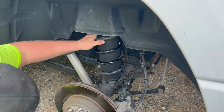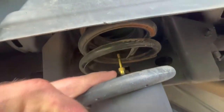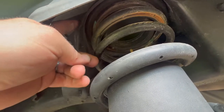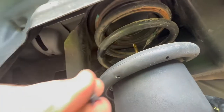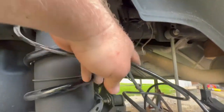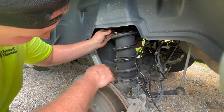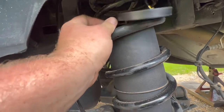With the suspension dropped you can easily get to the nipple on top. You can see this is the top of the bag, and up there it's hollow so you can reach your hand up on the outside and poke your fingers down. The hose goes right down the center through that, then you hook it in and put your hose clamp on it. The hose is fed down to the middle on top, then comes over here. Take the hose, shove it onto the nipple making sure all the rubber is over the barbs. Then an important step: put the puck over top.